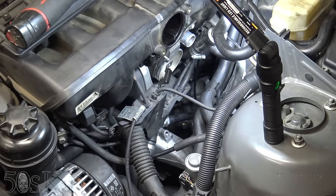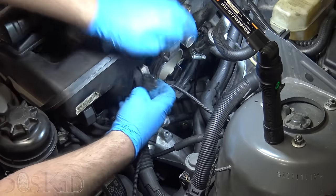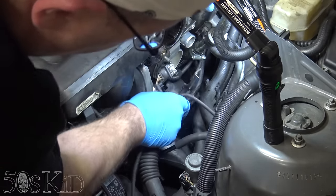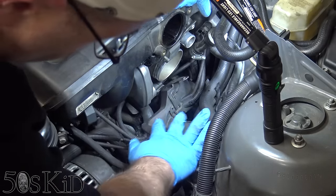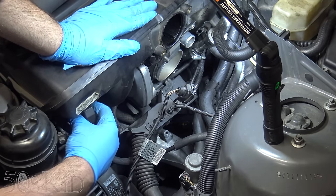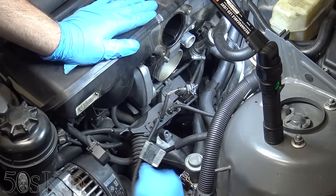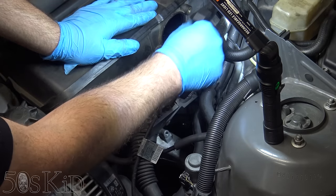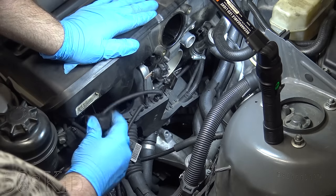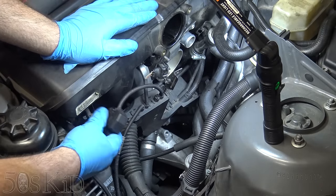Once the electronics box comes away, we need to disconnect a few things from it to get it to pull back all the way. We'll need to disconnect the idler control valve — just push the little metal tab and it pulls out. Now you'll notice this one right here is the EVAP purge solenoid — we're going to disconnect this. It's a very distinctive connector because it's reversed. There's only one other reversed connector and that's for the DISA valve. You'll notice that one is not long enough to reach over here, so that's how you tell those two apart.